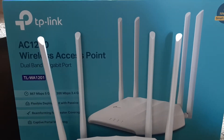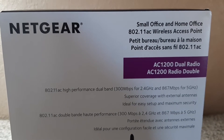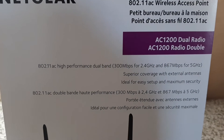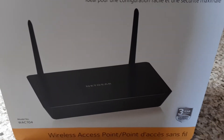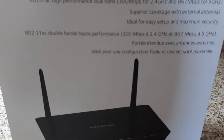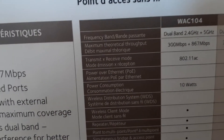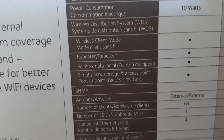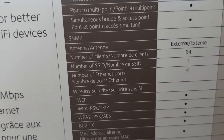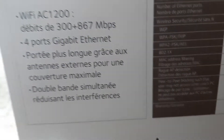One of them I had for about a month. But when they do work, they're awesome, and I wouldn't have bought them if they weren't. So next up is the Netgear WAC104. It's the same Wi-Fi 5 standard, 802.11ac, which gives us a 2.4 GHz band and a 5 GHz band for a total of around 1200 megabits per second. Both of these are designed for small office and home office use, ideal for small business. It says it can handle 64 clients, has only one SSID, but it has 4 ethernet ports — and it claims a 3-year warranty.